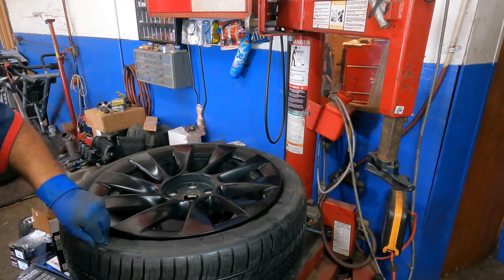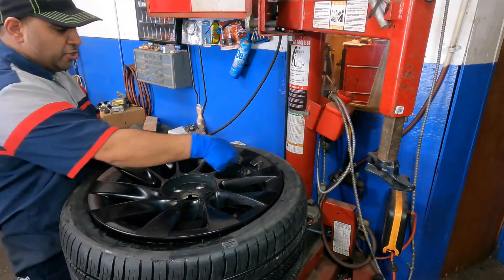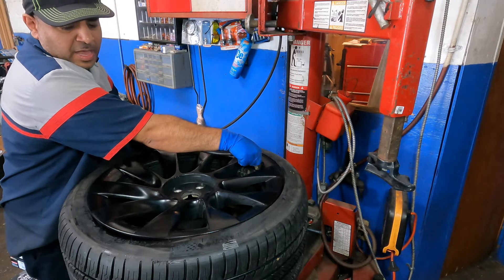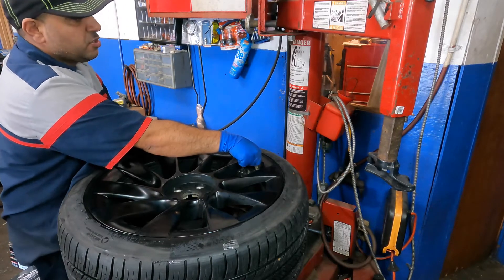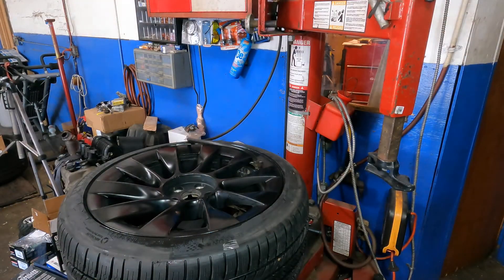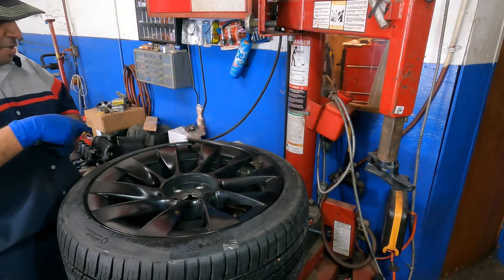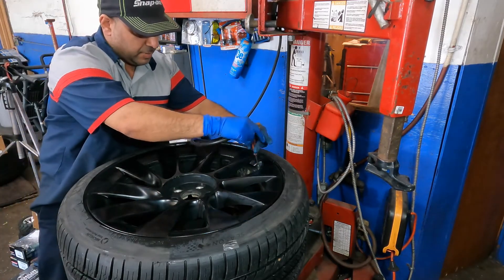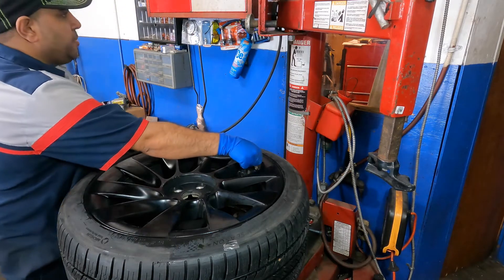Money talks. I'll charge for the service. Now I'm going to inflate to 40 psi. It's hot summertime so even at 38 psi it will reach 40-41 once warm. Balancing is the part you won't see me do in detail since my balancer isn't the greatest — I'd recommend taking it to a shop. I do slow local driving so I'm fine. Once you get new tires make sure you get an alignment done.